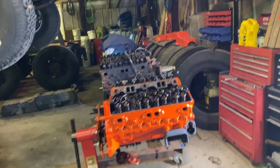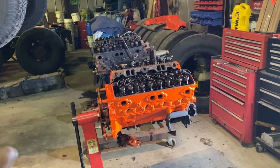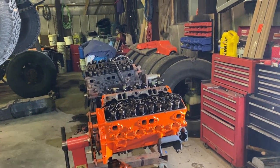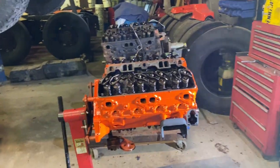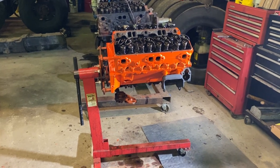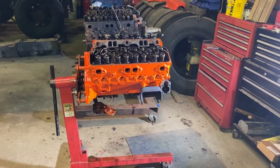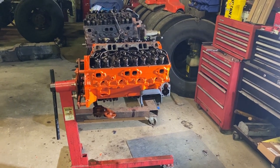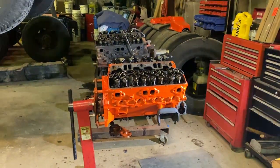I just don't want to have to pull the whole bottom end of the engine out. It's a fine running motor. It just needs a camshaft, and it just so happens that the motor's old, so it needs cam bearings, but it had plenty of pressure, so I'm hoping a high volume, high pressure oil pump helps the motor out a lot. And maybe it'll soothe over some not so good cam bearings, but that's my own chance I'm taking if I decide to go that route.